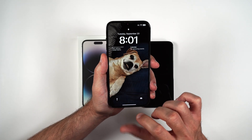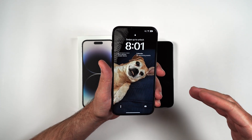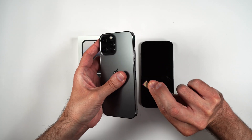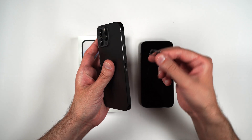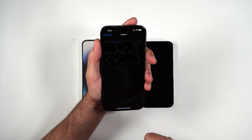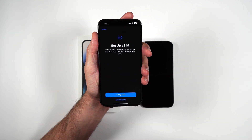Looking at my old iPhone 13 Pro Max, as you can see there's an SOS signal up at the top, signifying that the old SIM card has now been deactivated. So we're going to take that SIM card out of the phone — no more SIM card. Now we're going to go into Settings, then into Cellular, then 'Set Up Cellular,' and set up our eSIM.